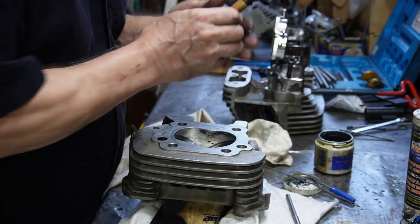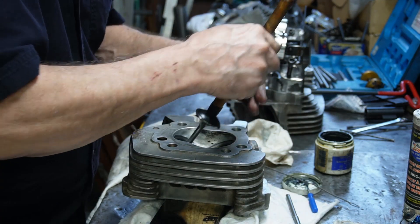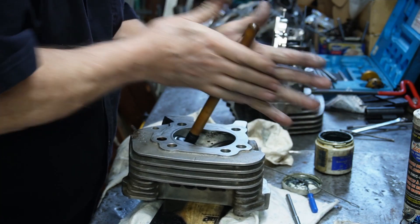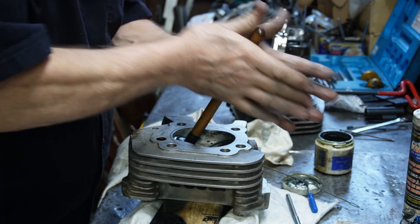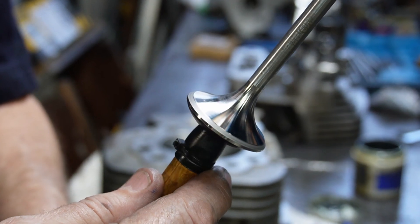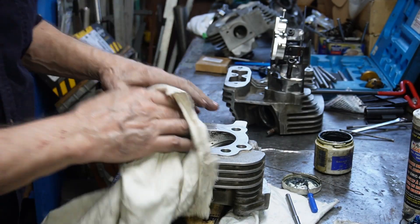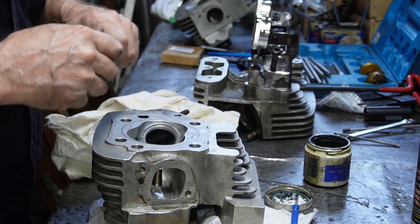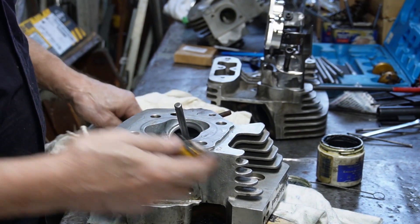Beauty. Just let it have a little run at it. It's pretty light. Now we've got a nice satin sort of finish around there, all around the valve — nice and even. I think that's pretty good other than dressing it up a little bit. I think I'll take a cut with both the 31 and the one on the bottom, and that will really give me a nice clean look at where I'm at there.